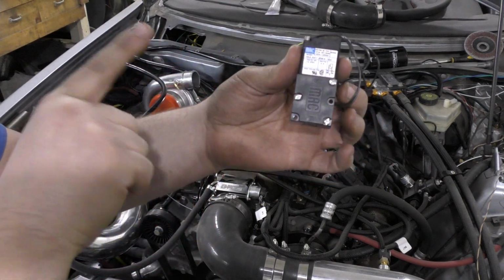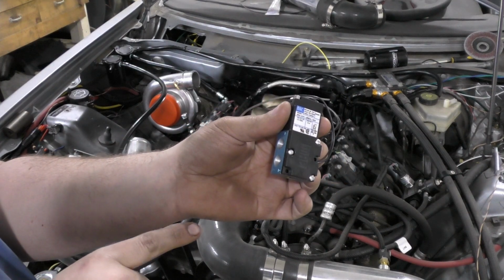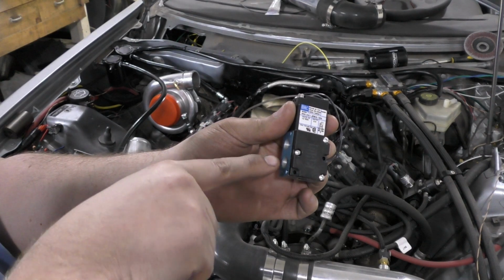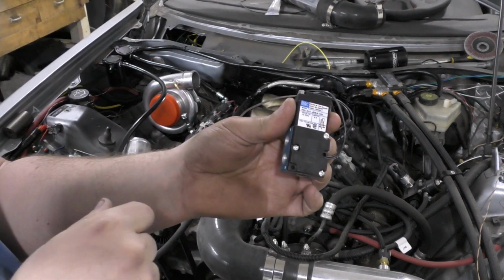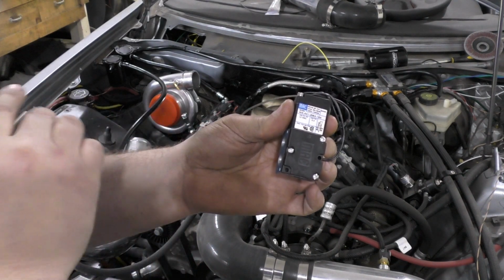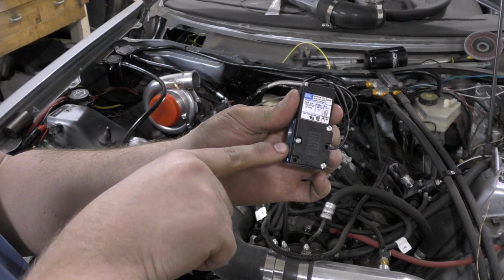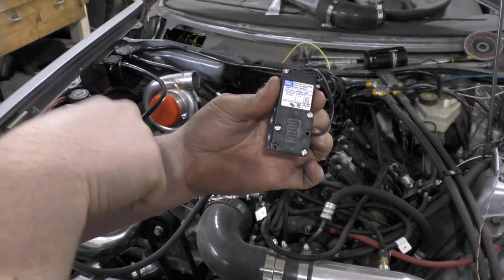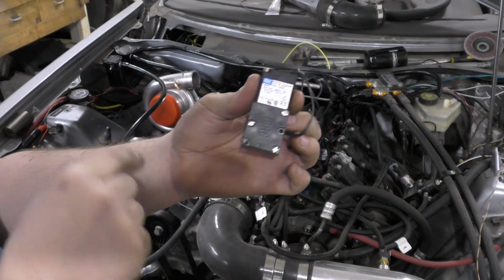So essentially, we might have a 5 psi spring in the wastegate. As you get closer to that 5, it will start adding air here until it pops the valve, so then you're staying at the 5. But if we dial it in to go to, let's say, 20 psi, this will essentially vent everything, and then it'll start adding air to the top, pushing the wastegate down until it reaches that 20, and then it'll start venting this off.